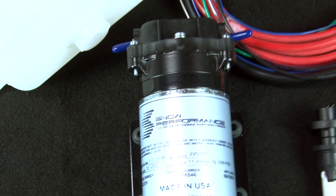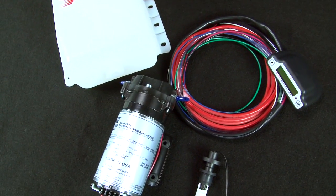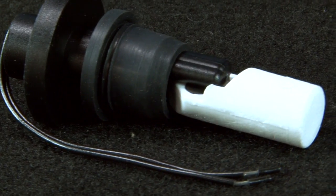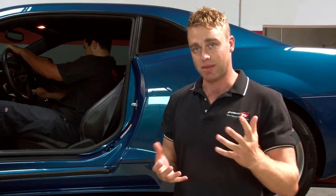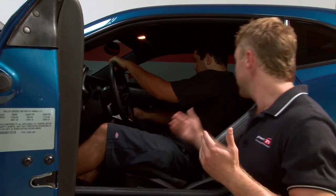This Stage 3 kit is designed specifically for the Camaro, and takes about four hours for a do-it-yourselfer and about two to three hours for your local professional. We'll be back in around about five hours while Sean gets started. Snow Performance designed this kit specifically for the Camaro — it utilises your stock windshield washer reservoir with a drilled hole to feed the pump. A fluid level switch is mounted in the reservoir to warn if the level gets too low, and the pump needs to be mounted so the inlet is at the lowest point of the reservoir. The nozzle should be installed 90 degrees to the direction of airflow, ensuring maximum cooling as the nozzle sprays in a cone pattern. We're going to run the Camaro first without the Snow Performance kit activated to get our baseline numbers, then upload the tune file with the optimised air-fuel ratio and timing curve for the WaterMeth system. We've got Ryan Cunningham here from Cunningham Motorsports to give us insight on tuning one of these WaterMeth systems.